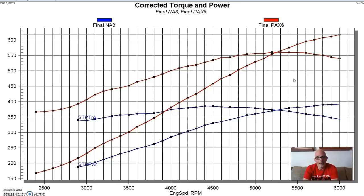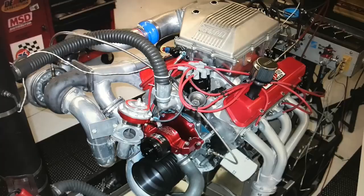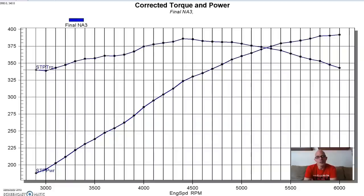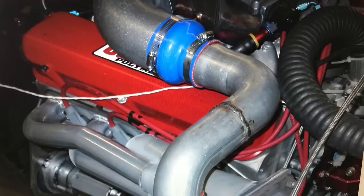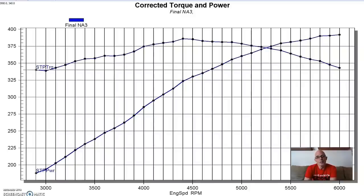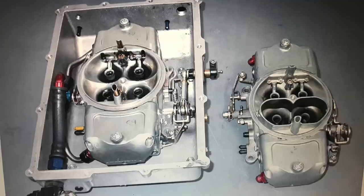Now that we've taken a look at the centrifugal supercharger, let's step up to the turbo. The final test on our small block stroker Ford was a single turbo system from HP Performance, originally designed as a fuel-injected 5.0 turbo kit, but it worked very well on our carbureted combination. All we had to do was route the boost from the turbo discharge up into the carb enclosure borrowed from the Paxton kit, blowing through the 750 Demon carburetor.